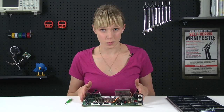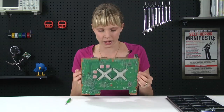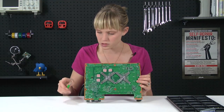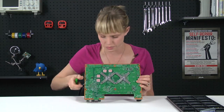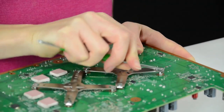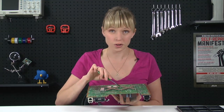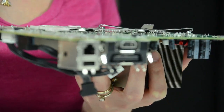Now that we've got the motherboard removed, we're going to need to remove the heat sinks, which are held in place by these X-clamps down on the underside of the motherboard. To do that, I'm going to use the flat end of this screwdriver and just kind of pry up each end of these. This last clamp is what's holding the heat sink on, so before you go undoing it, make sure you support the heat sink — that way when you undo the clamp, it doesn't fall on the ground.